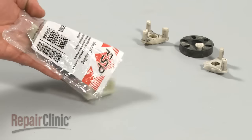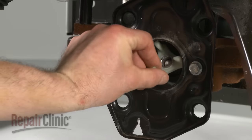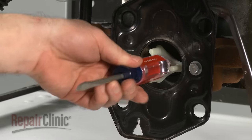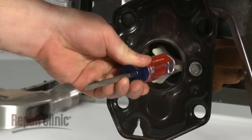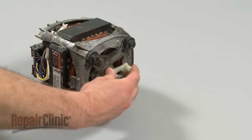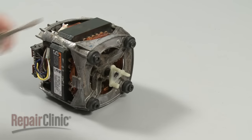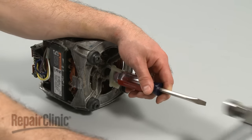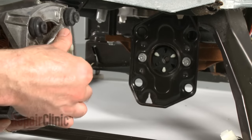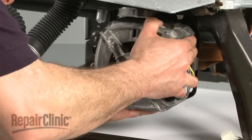You're now ready to install the new drive coupler. Carefully push one cog of the new coupler onto the gear case drive shaft as far as it will go, and slide the new isolator onto it. Carefully push the other cog onto the motor shaft until it is flush against it. Line up the prongs on the cog with the holes in the isolator and slide the motor into position.